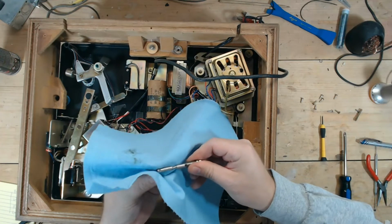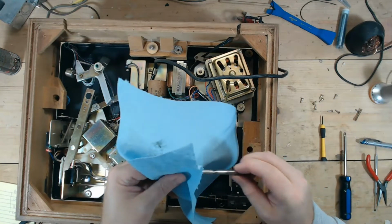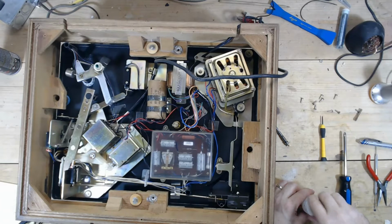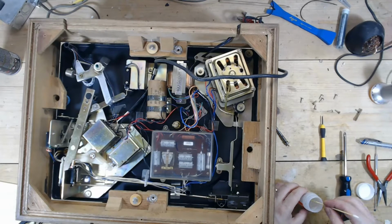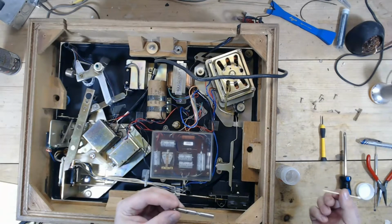So clean off all the old damping fluid. And I usually just kind of eyeball this. Sometimes to me it's better to have this a little slow than too fast. A little slow, you just have to be patient. Too fast, you know, when this drops down and hits that record, you can damage the stylus, you can ruin the cartridge, you can also damage your gear. So